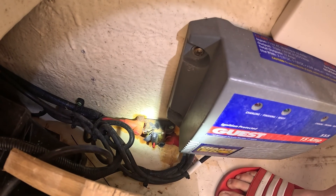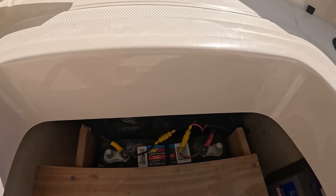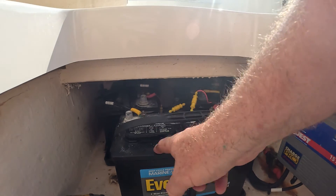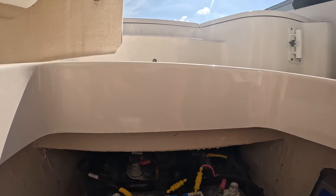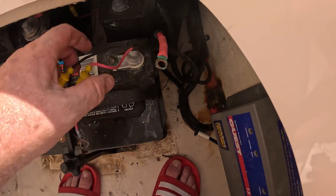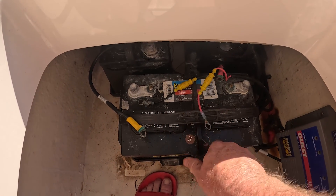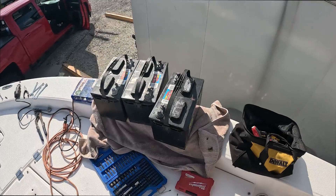It's all going to get replaced — new fuse. I'm not going to replace batteries, I'm just going to clean them up. There's not a whole lot of room in here to work, so I might not be able to show you much of what's going on. All right, three screws — got that wooden step out of the way. This is going to be pretty easy to undo. I'm going to do the batteries, undo the bolts, pull those out, and then get down to the fuse. Just looking at the cables — even my charging cables need to be cleaned up. We'll pull all these batteries out so I can take them to the house and get them reconditioned and recharged. All right, those suckers are out.